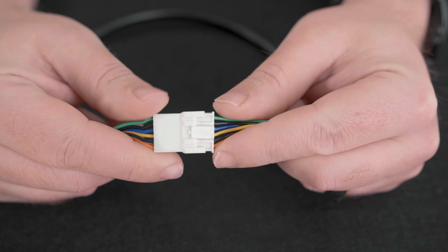You may find that a wire has been pulled loose or has come completely disconnected from one of the wire harness connectors. You can usually reseat the wires in the connectors. If a wire has come loose, press it into the back of the connector until you feel it click or lock into position. If the wire has come completely out of the plastic connector, it can be placed in the back of the connector and pushed on until it locks into place.